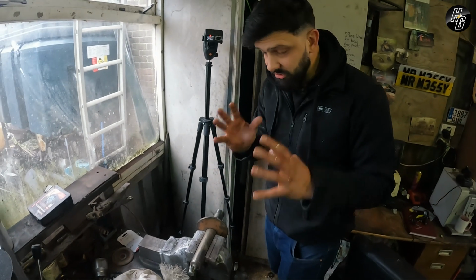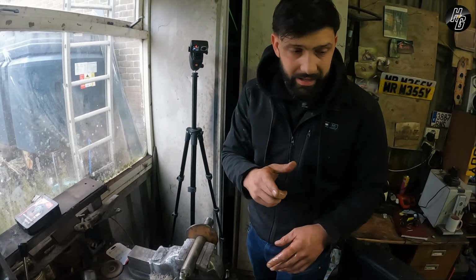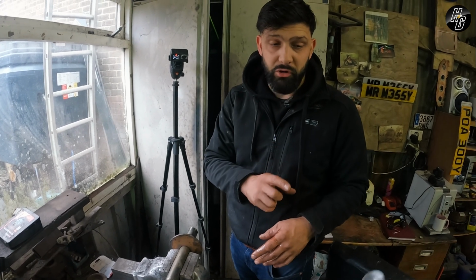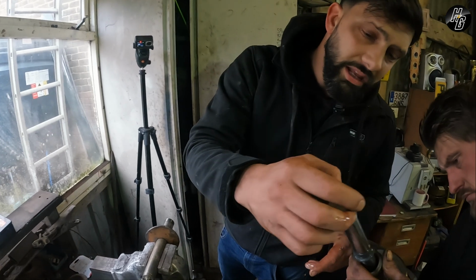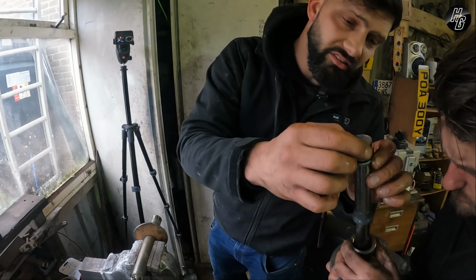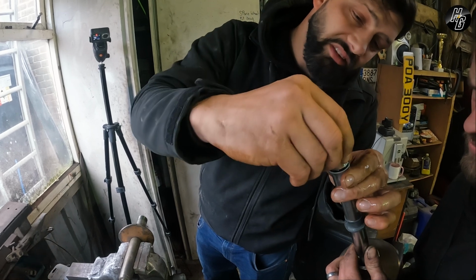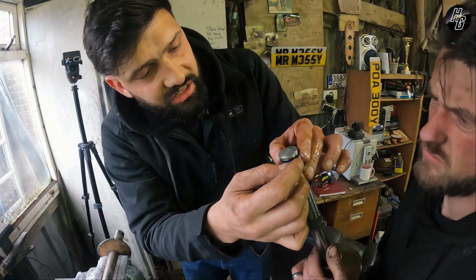So that ram is completely taken apart and we know what is wrong with it. I'm going to send that to the legend at Lay and Play, see what he's got. But Josh had a really good idea. We could run that up to HP Hydraulics and they might have those clips in stock. My only concern is the actual O-rings are not too bad. That one's got a split in the plastic, and it's split on both sides, you see, it's two pieces.